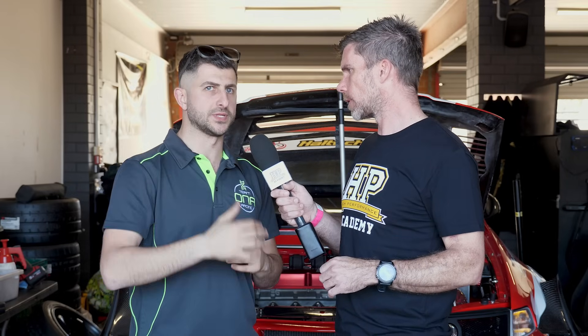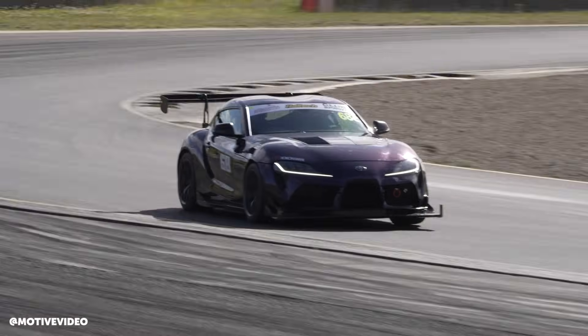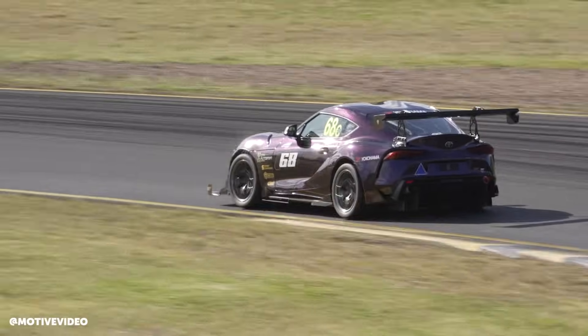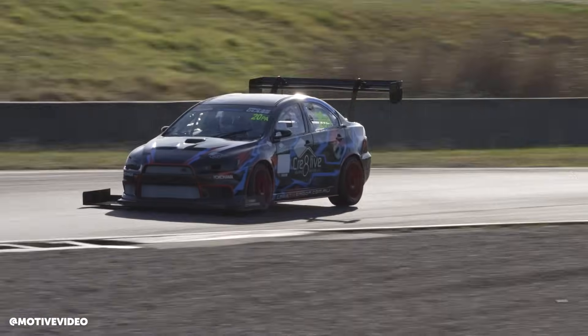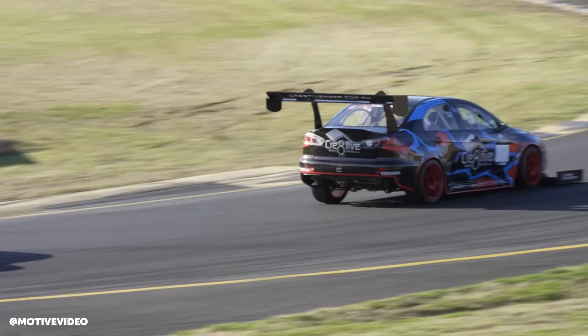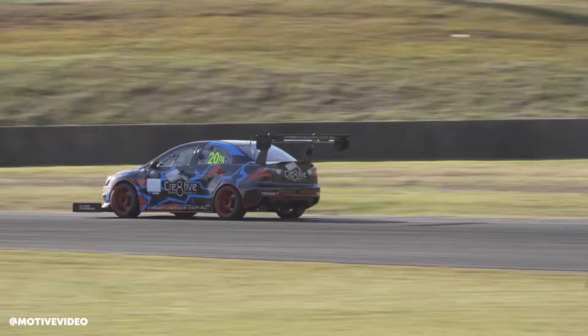You might say for a particular vehicle you'd like it sprung between 1.5 Hz and 1.65 Hz, so the car should be happy between an 8 kg/mm and 9.5 kg/mm spring. Based on our track experience, we might lean on that and say for an Evo with its all-wheel-drive system, let's go softer. If our thermal imaging testing on the tyres shows we need a little bit more, we can step the spring rate up, but we'll always find the window pretty quickly.